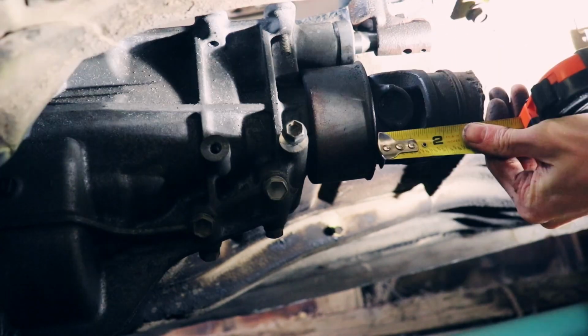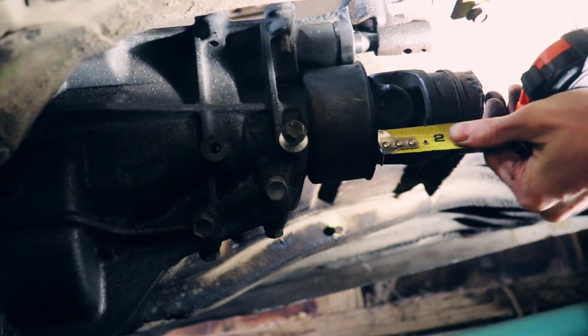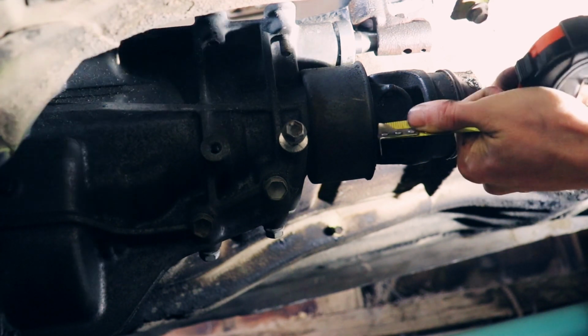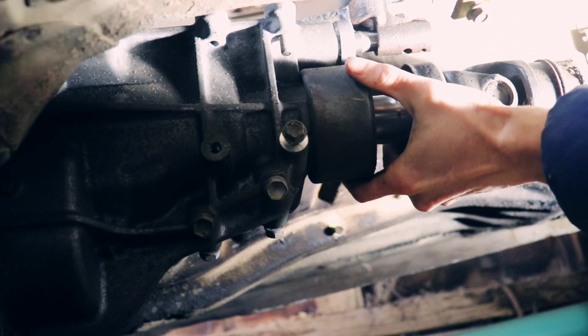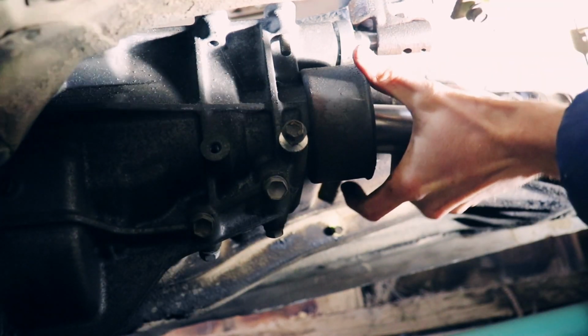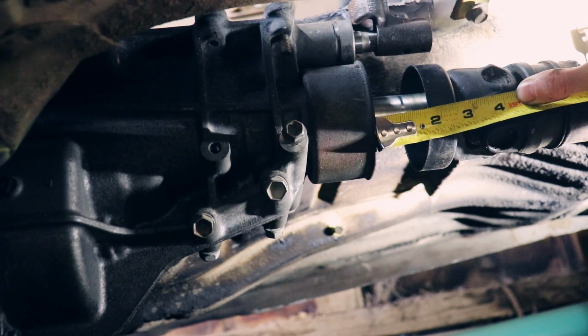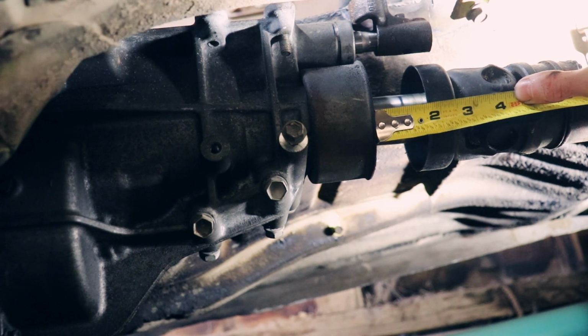Okay. So from this flange to the center is about an inch, there's 3/4. Yeah, right about 3/4. I'm just trying to see when it engages. So it engages a little bit before here, but let's be conservative. That means all the way butted to the flange. That's 4 1/4 right there. So if you subtract 3/4 from that, you have 3.5 inches of engagement when you're fully compressed.